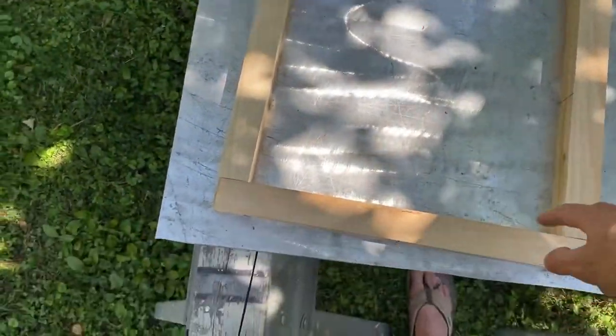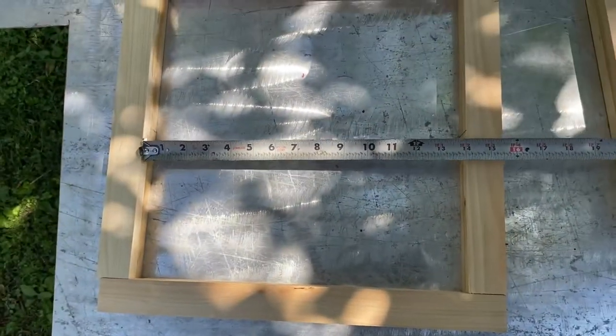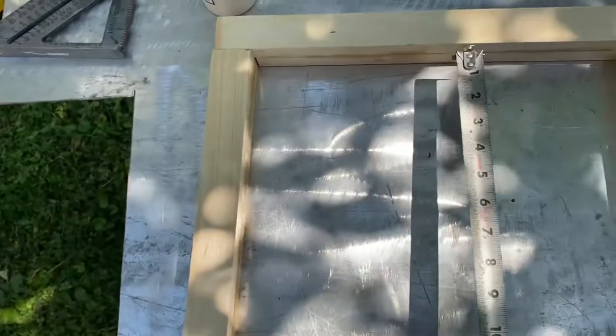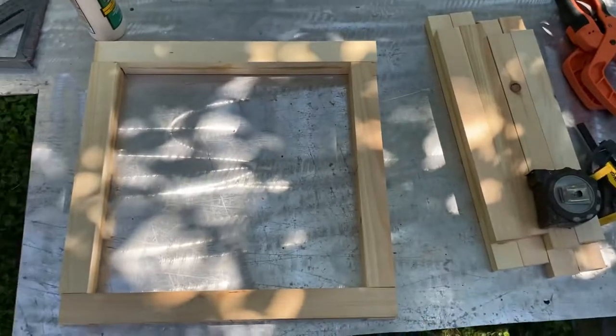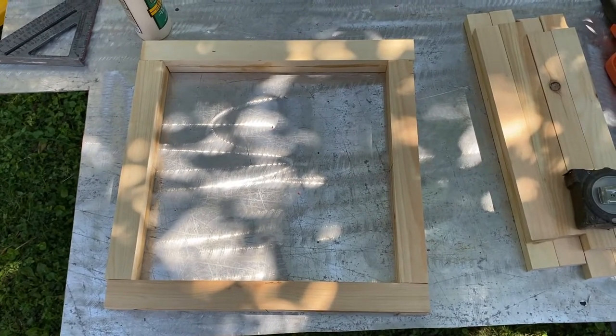And so once we get done, we have a clear 14 inch open. And then this sets to go on the underside of the van, so the Maxx Air fan flange has something to screw into. So we're just gonna put them together, glue them, clamp them, square them up, and then we'll paint them just like we did with the floor ribs that are in the floor.